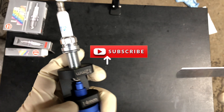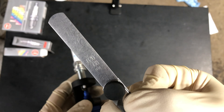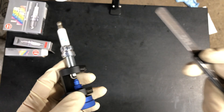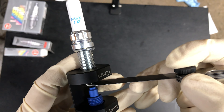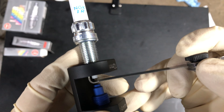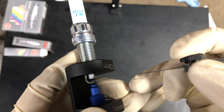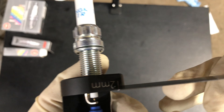For those curious, this is the spec I am running — it's two hundredths of an inch (0.020"). This spark plug is already gapped. You can see how it's kind of hard to get in there; it has a nice drag to it. Obviously you don't want to force it in there and damage it, just be gentle with it.